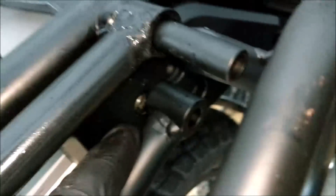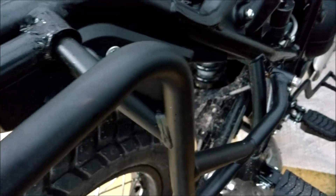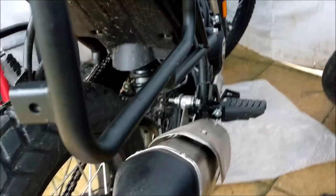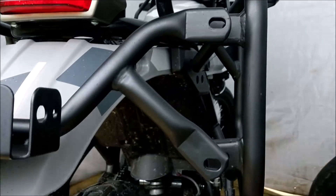I've just wound that bolt back in, and this is sat inside that recess — it's pretty tight but it's not properly tight. Look at the gap we've got here, because that's too long; that channel in there is too thick, not shallow enough. So the problem is when you go to put the back bracket on, you can't line up on there.